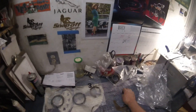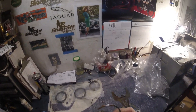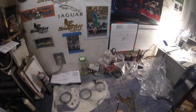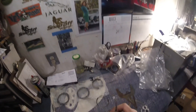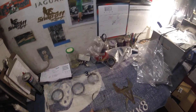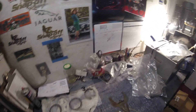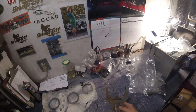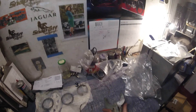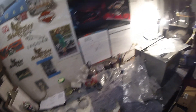The two tools I use are this, which is a broken piston ring — the little white piece there indicates the machined end. The other end is where it broke, or I deliberately broke it. This is going to be used to clean out the grooves if I need to. I've cleaned them once, but sometimes you don't quite get it, and once you put the rings on there, then you'll know. The other is this little piston ring expanding tool. Very nice little tool. I've had it in my toolbox for years and I've hardly used it. I used to just pull the rings apart and put them on — not the best way to do it — but this tool does it so easily.